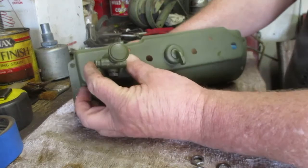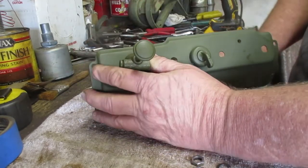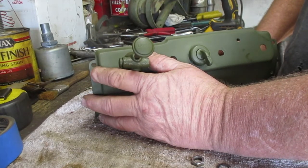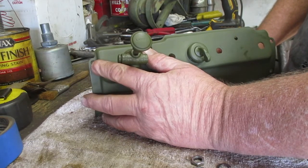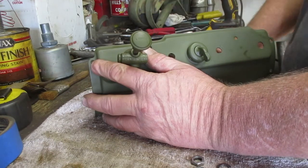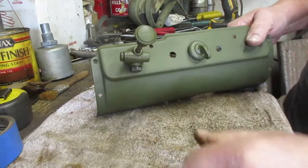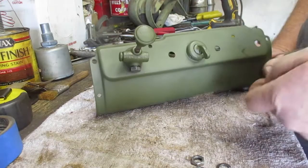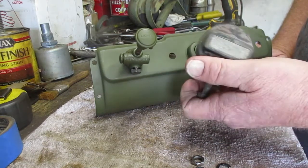And then the button is pushed, and it's pulled out a second time. And that lights up the main headlights and the driver's side running light, which turns red. And it also keeps the brake light working. And we pull it out all the way. The only thing that lights up are the marker lights in the taillights and on the fenders.